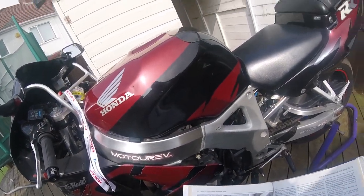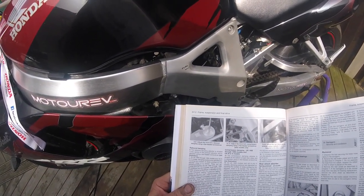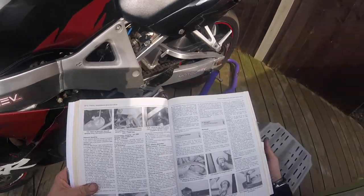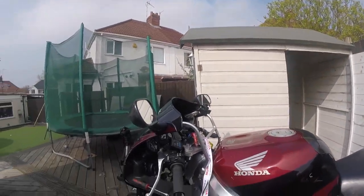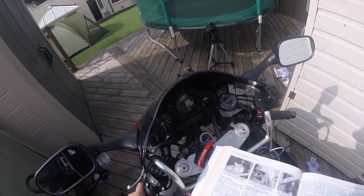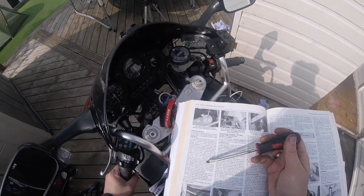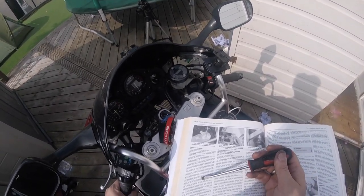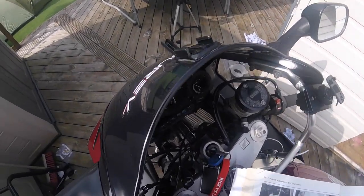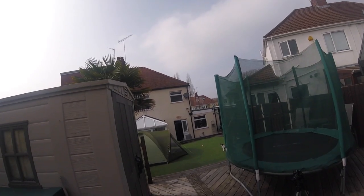Adjust the front fork rebound damping using a flat bladed screwdriver. The rebound damping adjuster is situated in the centre of the preload adjuster. Okay, that's my screwdriver. So we will go with the left side first to establish the present setting. Turn one of the adjusters fully clockwise while counting the number of clicks. Okay, here we go. So listen for the clicks and the maximum.